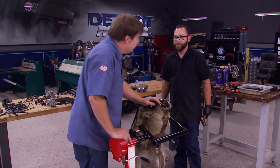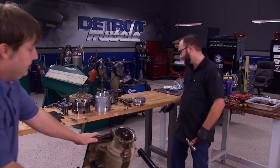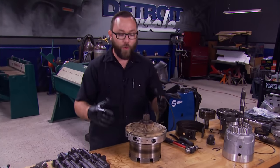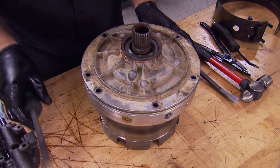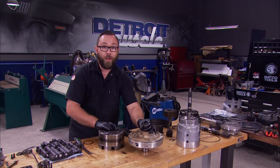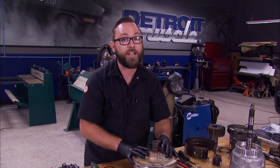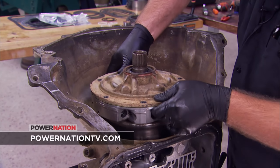You've been making pretty good headway getting this transmission empty. I'll go ahead and get a jump start cleaning it up. I've got to get over here and get the rest of these internals torn down. So what we're going to do next is tear into the internals of the transmission now that we have them all on the table — in the order that they came out. So the first thing we're going to get to is the pump, which we have to remove from this reverse drum. Sometimes the drum and pump separate when removing the pump, which is okay as well. We're not going to show you every intricate detail of how to rebuild this transmission, but for those of you that want to see it, go to our website PowerNationTV.com. For the steps to rebuild the transmission internals, hit the full episode section of PowerNationTV.com, click on Detroit Muscle, and look in the Bonus tab.